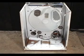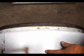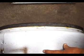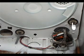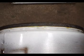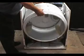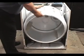Now all you have to do is put the dryer back together. Before you install the drum, take a wire brush and clean this track real good. The two drum support rollers are going to ride underneath of the drum on the groove. Grab the drum and set it in place.